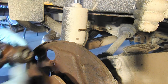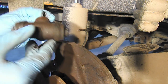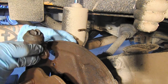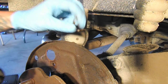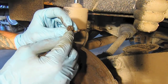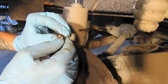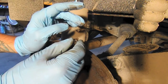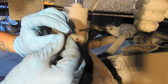Nothing is ever easy when working with old equipment. I managed to get the wheel cylinder out, but the connector was pretty frozen. I had to unscrew the wheel cylinder from the connector itself, but at the very end it was swaying and the brake line broke off right at the connector point. Now we have a bubble flare that we need to put onto this old brake line.